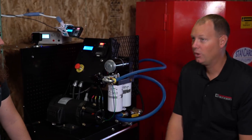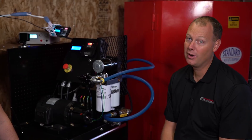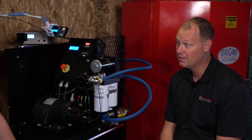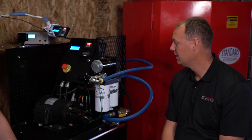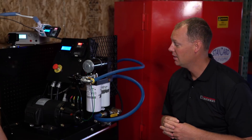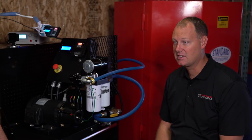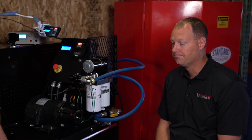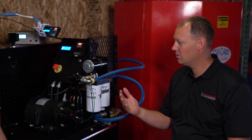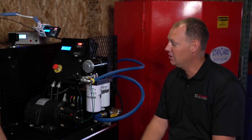Our thoughts on this pump: we were not able to replicate 125 gallons an hour at 45 psi at 14 volts — we were at about 105, roughly 20 gallons an hour short. At 16 volts we got pretty close. They advertise this from stock up to 700 horsepower, and from what we're seeing, that's believable — that's the limit of this pump, but that's what they're saying. The injection rate dropped as expected because this electric pump always delivers the same gallons per hour; unlike a mechanical pump where flow increases with RPM, this one never changes, and how fast you took away from that well determined how much power you could make.